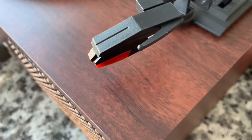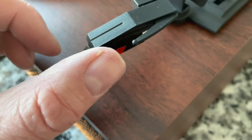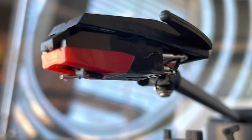There's a little finger lift on the front — it's kind of pointed forward, so the best way to leverage these is often to push inward rather than lift from underneath. Let's see if this has the higher-end stylus housing or the low end. This is the second turntable I've reviewed today, and two times I've been pleasantly surprised — even though this is an entry-level ceramic cartridge, it does feature the higher-end stylus housing. The little pole on the bottom, the cantilever, is metal. The very low-end ones have a plastic cantilever, which is not ideal, but this one does have those improved inner workings.